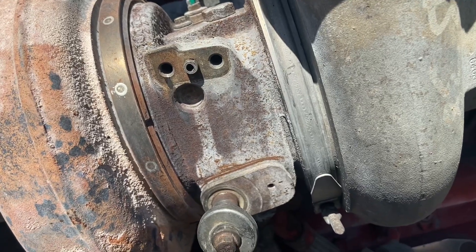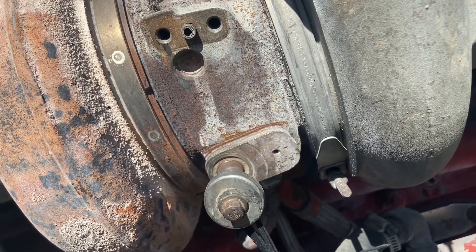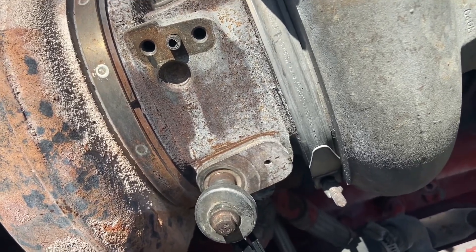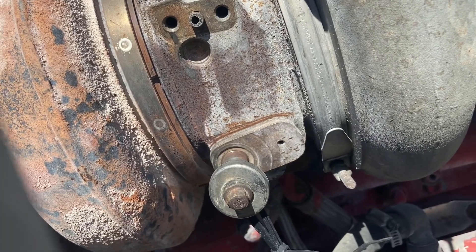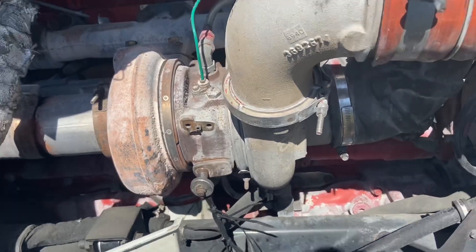So it will be in a fixed location. I'm going to run that for a few months just to see how everything lasts. I don't think it'll hurt the turbo. My EGTs have been perfectly fine, my air-fuels have been perfectly fine, it's not throwing any codes or anything. Doing experiments, trying to get the greatest results. I know what a lot of y'all are thinking — you're using zip ties to hold the actuator in place. Yes, I am right now, because I've been playing with the tension on the actuator to find out what that sweet spot is for the best fuel mileage, and I think I've got it.